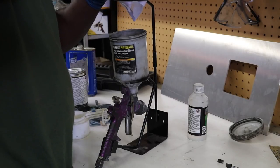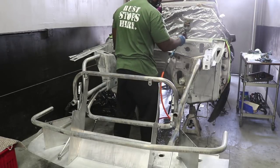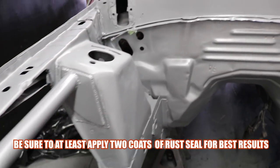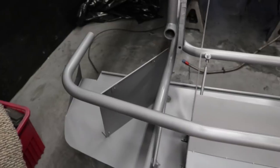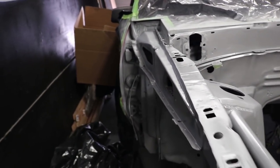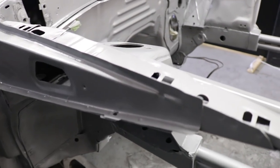This paint goes a long, long way — that has been my experience. Run it through the filter just to knock out any weird stuff. There it is — that is the KBS Galvanized Steel paint. Some parts are still wet but it looks like it's going to dry matte. Any parts I missed with the spray gun because I couldn't go vertical, I'm going to hit with the brush. The good thing is the brush doesn't really leave brush marks because this paint takes a while to set — it evens out all the way before you'd see any marks. Here are the areas that had the bondo — looks pretty good.